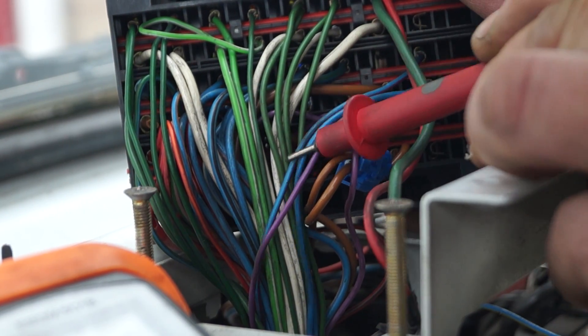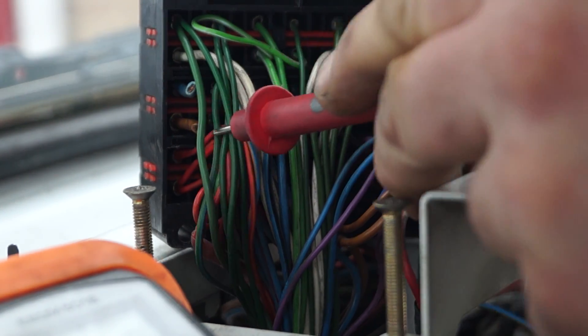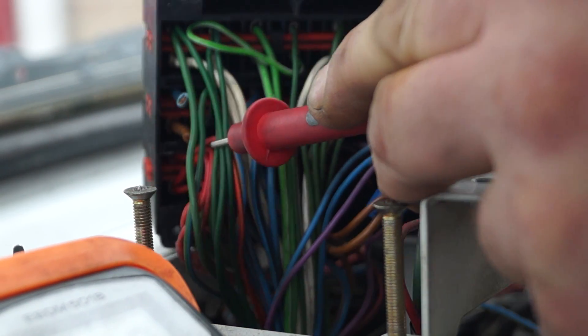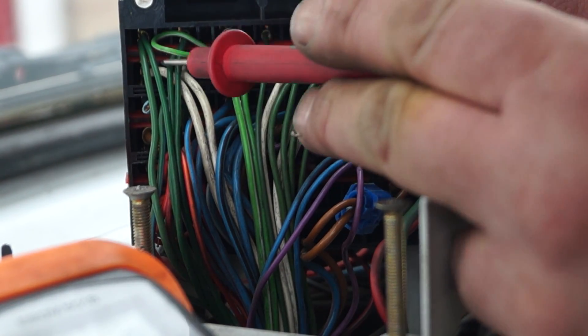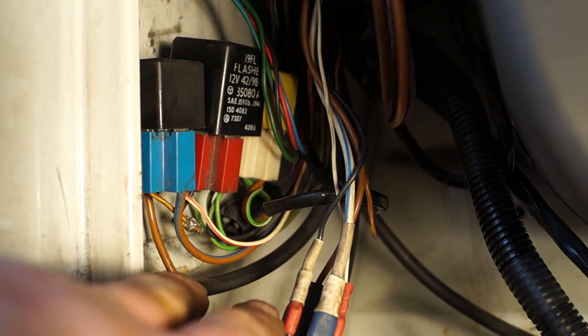This here is on the primary circuit and you can see the box has been chopped about a little bit — this would have been done in the factory because this fuse is not required. You'll also see one of those terrible scotch locks hiding away there from a bad repair. Anyway, the permanent live also goes to some relays, as you can see here.